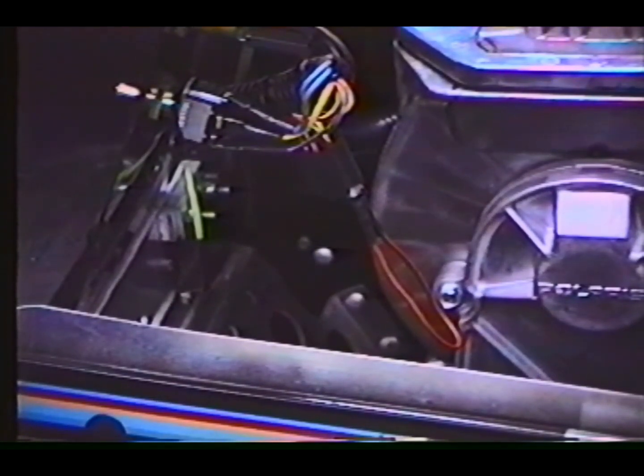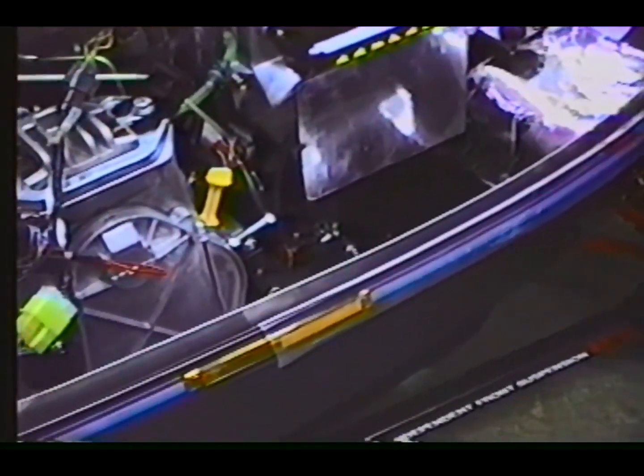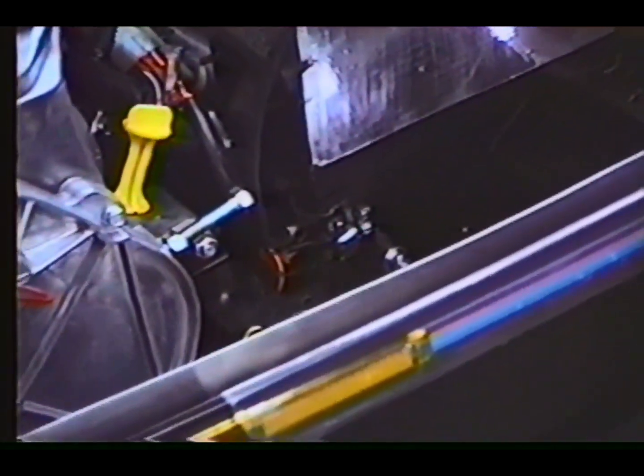The 1993 EFI 500s will also use a different protective device for the wire harness. Previous to 1993, we used a fusible link or wire. Now we will use a self-setting 12-amp circuit breaker. This circuit breaker is on the battery support bracket. Also located in this area is the ACS, or alternator controlled sensor. This sensor is located to the inside of the support bracket and held in position by these two bolts.